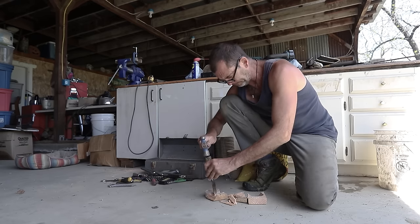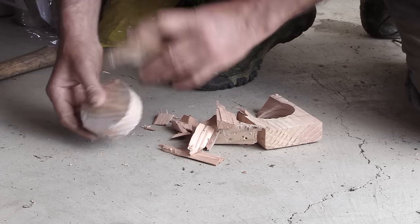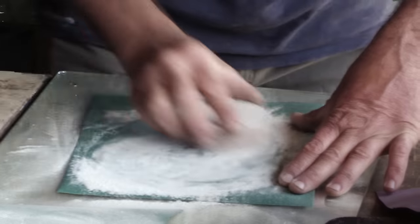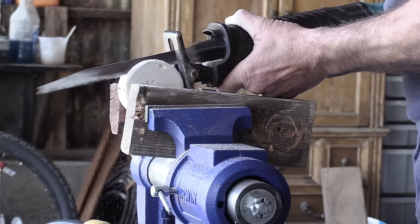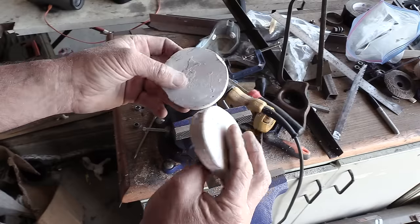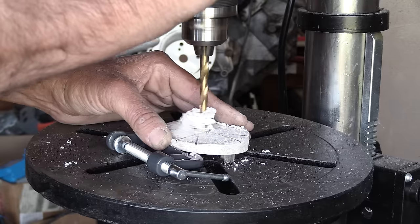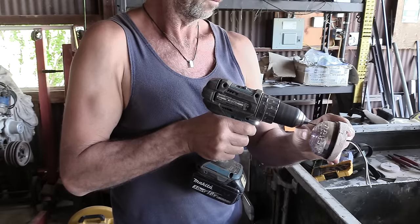Extraction of our asset from the mould does require some gentle force. And there we have it. Vigorous scrubbing on some coarse sandpaper overlaying a flat surface is undertaken for a more polished appearance. Now we cut our creation in half, but on an angle, from thick to thin, or vice versa. Now the undercarriage is given a good scrubbing as we attempt to match the curvature of the front wing. A central hole is drilled for the wires, an attachment point for the light itself.